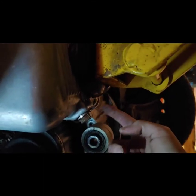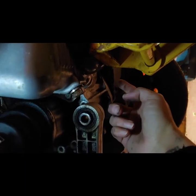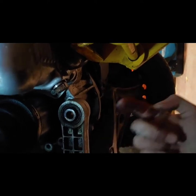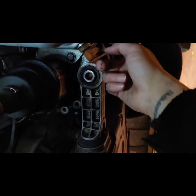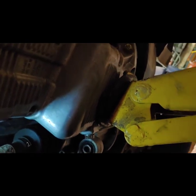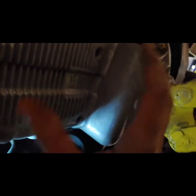From where the pan connects up to the transfer case on the driver side, there's basically a bolt that comes this way — don't forget about that. Then underneath on the pan at the very front, there are black little covers you've got to remove in order to get to those two 10-millimeter bolts that are way up in there. You need an extension to reach them.